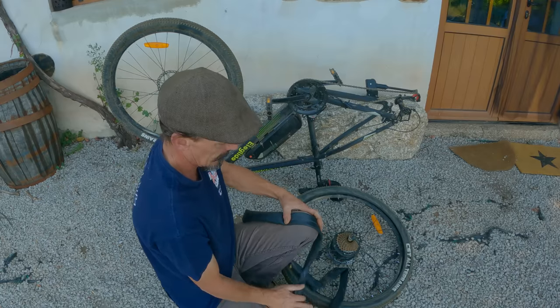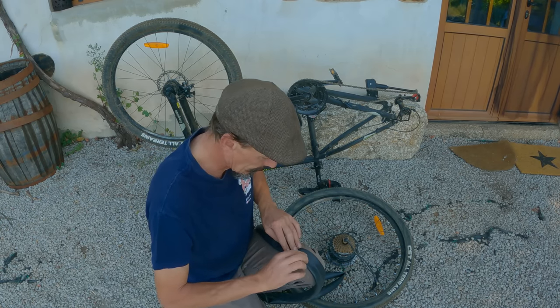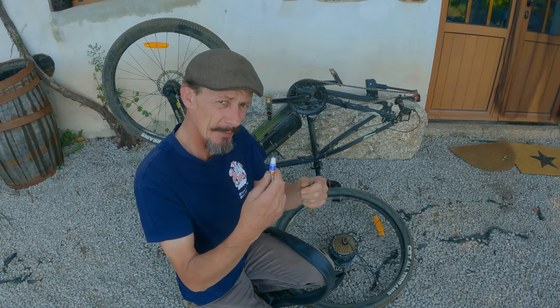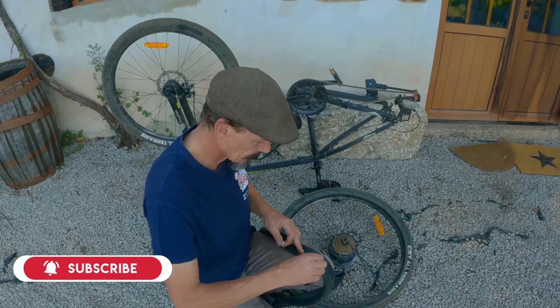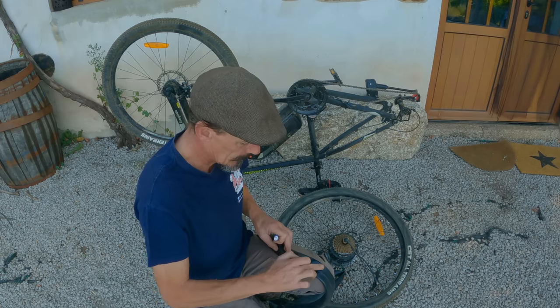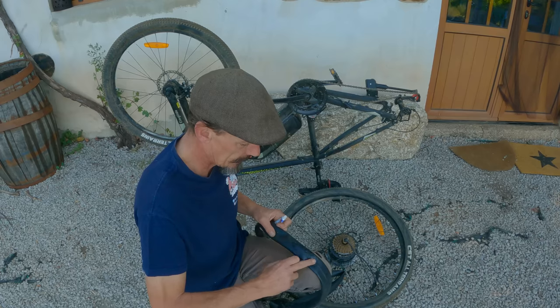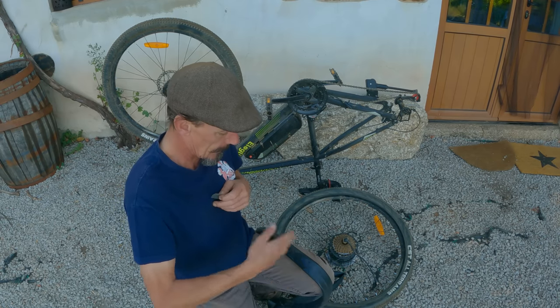So what we'll do there, keep it nice and flat on your knee, get my patch there. That should go over there a treat. So now, glue, and again, like the sanding, always put on slightly more glue in a bigger area than the patch. In small circles. What we used to do at the end, as it's going off, is just touch it with your finger, which roughs up the surface. There we go. There's my patch. Let it go tacky.